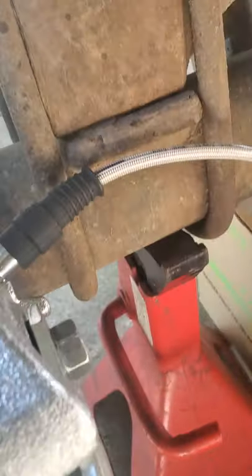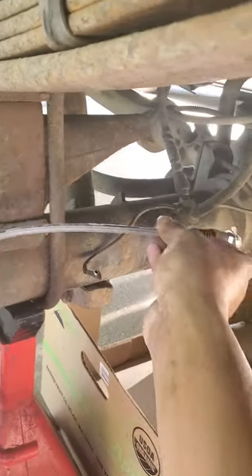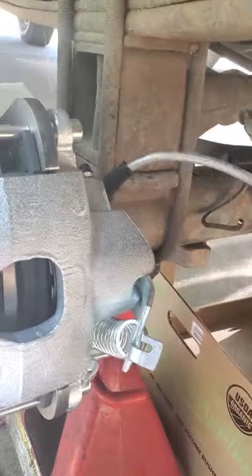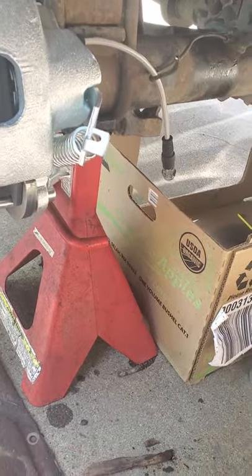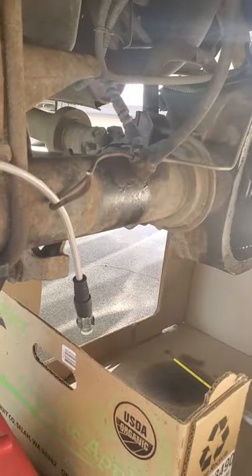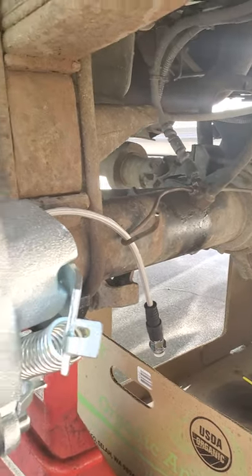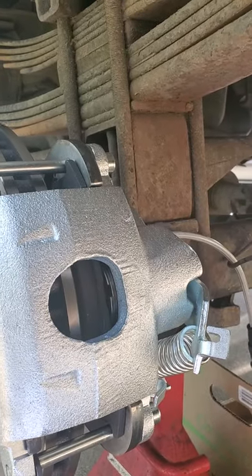Once again, you're going to have this plate here in the caliper. I'm going to have to cut this spring from the emergency brake and try to run it up through here to see if it's the proper length. As you can see with the upgraded steel braided hose line on the driver's side, this actually almost mounts directly to that T, so I'm going to have to figure out what to do there. I got new line all the way around from Amazon — it wasn't very expensive and it comes with the fittings. I also bought the flare tool kit. You're already going to have to pop off your rear diff — make sure you drain that in order to get these axles out. None of this was super difficult; you're going to need that one specialty tool to get the axle out, and outside of that, nothing crazy.